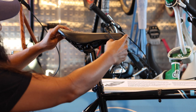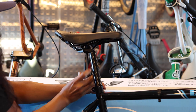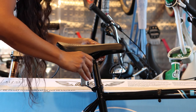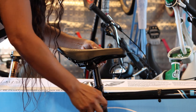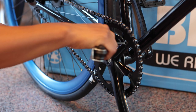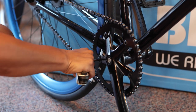Adjust the angle of the seat and its position on the rails using an allen wrench on the bolt underneath the seat. Adjust the seat post to a comfortable height and check that the seat clamp is holding it securely in the frame. Check that the bolts in your cranks and sprocket are all tight — applying grease to these bolts is also recommended.